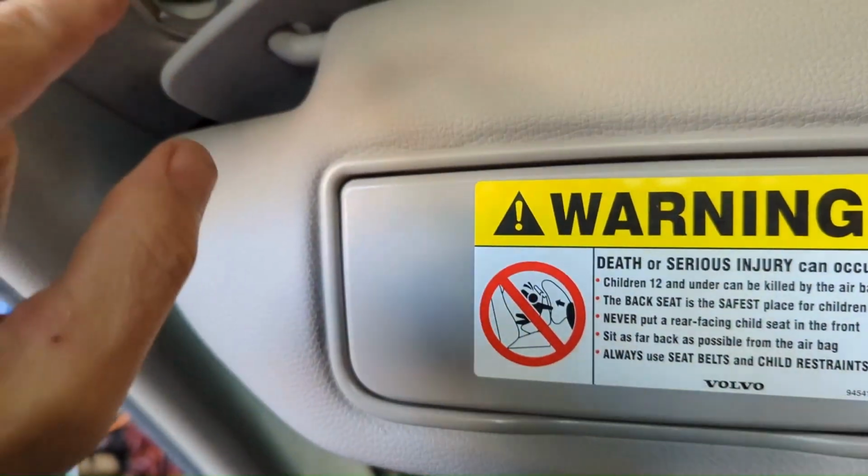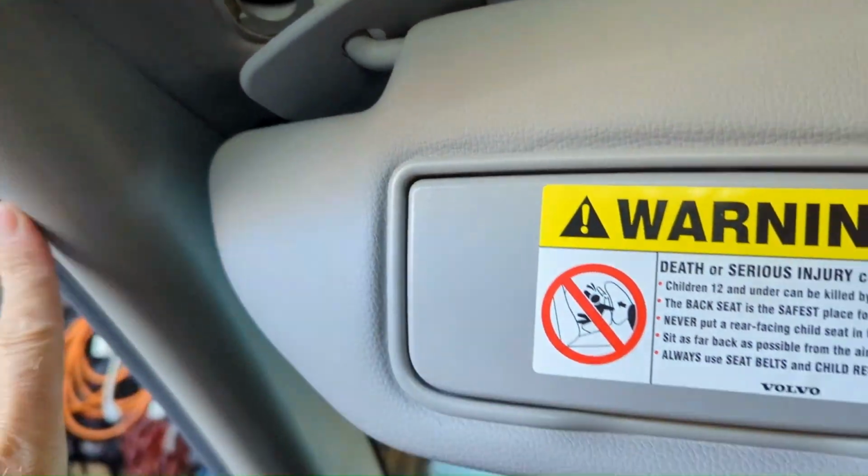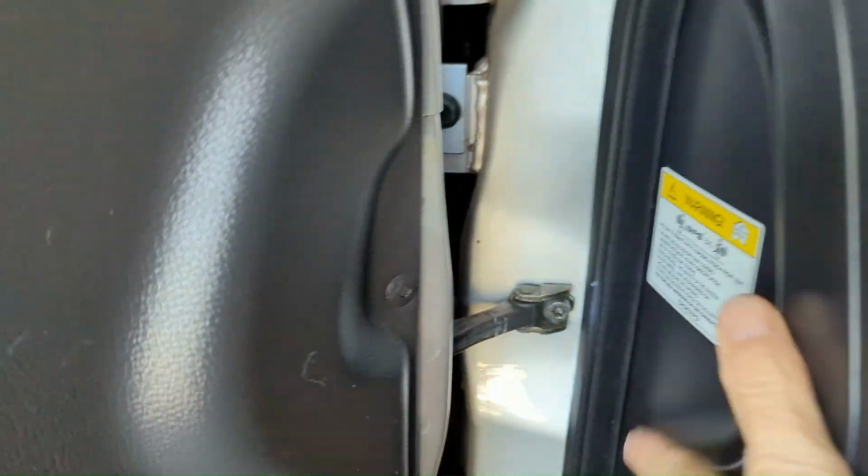All right, YouTube, already pulled off the driver's door. Oh shit handle. I'm going to run the power from here up into the headliner. I already took this off. I'll show you that in a second. Got this pulled off so I can get access to the bolts. I'm going to run it down the A-pillar. And then right here in the fuse box is where we're going to do our tap. So we'll get to that here in a little bit.